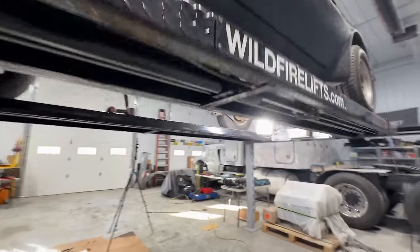There's a little bit of surface rust but things seem decently solid in here. I'm going to try out this Rust Check High Build Stone Shield. I'll obviously clean this all out and wire wheel it, but I just want to see how it works — oh yeah, that's going to be beautiful stuff. I was thinking of using this in the trunk as well as underneath the car. Once I needle scale all the rust off, I'm just going to spray this everywhere — I bought about six cans of it. It'll put that nice rock guard look on there, easy peasy.